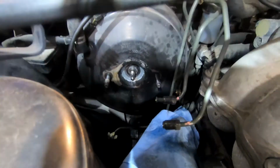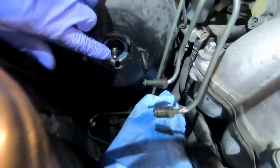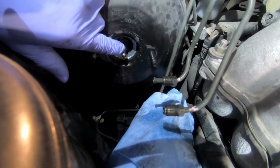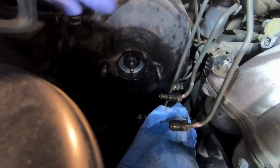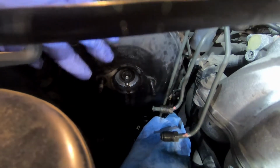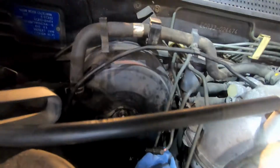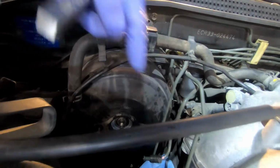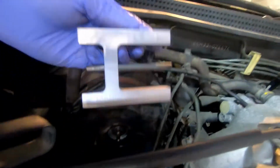So another pro tip, every time you do this, you should actually be checking the brake booster push rod adjustment with a tool like this. This is the brake booster push rod, and this actually has a length that you need to set, and with variations in brake boosters and brake master cylinders, every time you replace a booster or master cylinder, you should be always double checking the brake booster push rod length. I will link my video in the description below. I'll be honest, 99% of the time nobody does this, but 100% of the time you should be doing this.